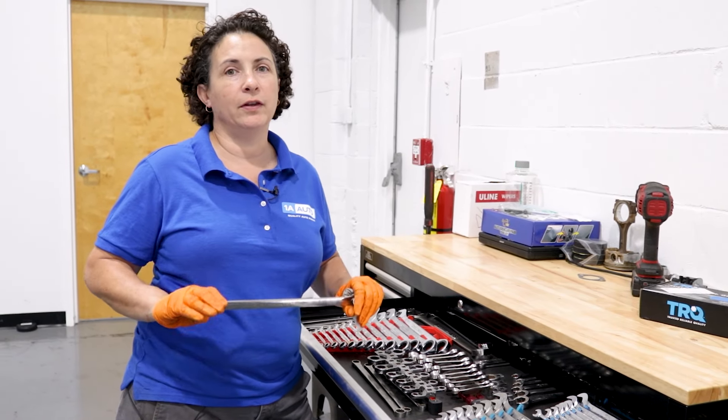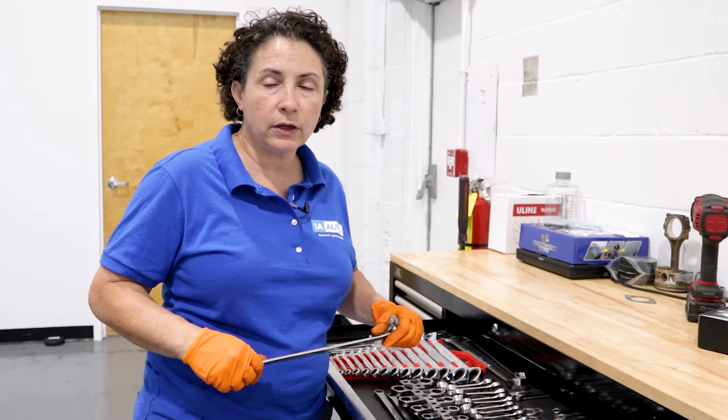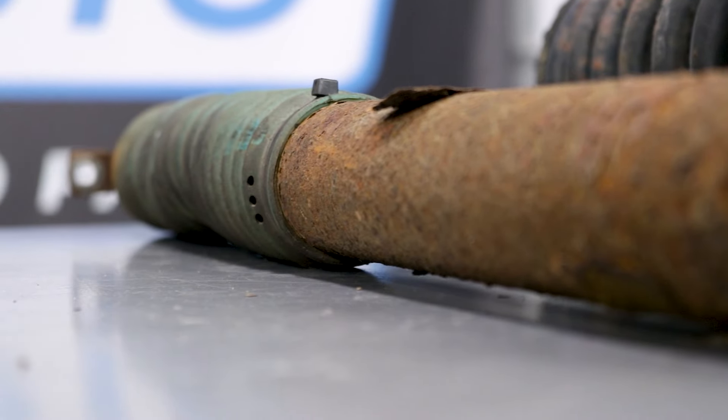So in conclusion — what's in a strut and shock, and when do you know when to replace them? What's the problem? Well: one, noise; two, leakage; and three, age. If they are of long age, some cars can go up to 120,000 to 130,000 highway miles and you might not need to change them at all. But if you have rough roads, a lot of potholes, or dirt roads that you travel a lot, you're going to hear them break down a lot sooner. You'll start hearing noises. You'll notice maybe on an inspection they'll say your strut's leaking — those are the times when they're losing compression and they no longer will take that absorption of the road. So: noises, oil leakage, and handling too — because that's a key part of steering: the suspension, the strut assembly, or shock.